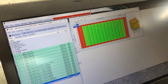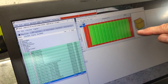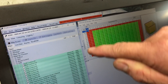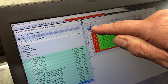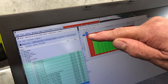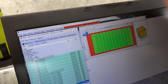So effectively what your resistor is trying to do is tell the engine ECU to fall into the red zones so it will not turn EGR on. Look at the temperature your engine ECU thinks it's operating at - it's either going to be minus 20 or 80 degrees on the vertical scale, or minus 20 up to 80 degrees on the horizontal scale. So it's going to think the engine is smoking hot, the inlet temperature is smoking hot, or it's going to be freezing cold.